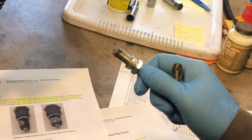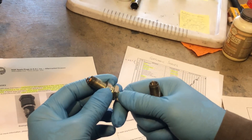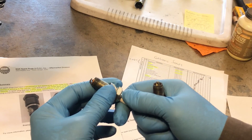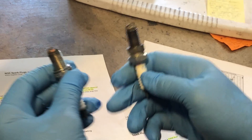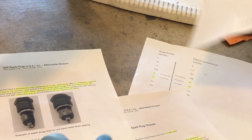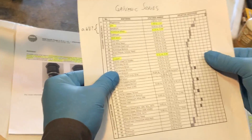Could you use grease for that purpose? Yes, but grease is relatively low temperature — there are some high-temperature greases, maybe up to 600°F, but at combustion chamber temperatures they're not going to last very long. Anti-seize does contain some grease as a carrier, but mostly it's metal.